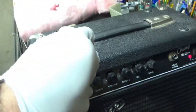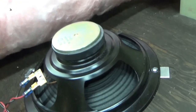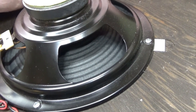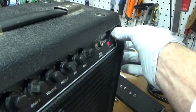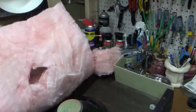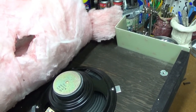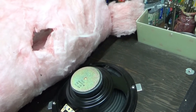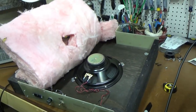Turn this back on and crank it up. If you notice, watch as I go lower — there's a frequency at which the tone coming in is an audible frequency but the cone actually stops moving. I think that's some of the distortion I'm hearing in the sound. But it definitely sounds better than the noisy Jensen, so I'm going to leave that one in there. I'm not going to throw that Jensen away — I think I'll try to fix it later on.